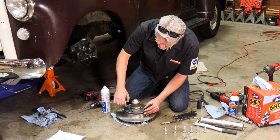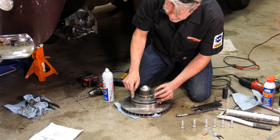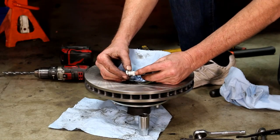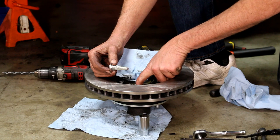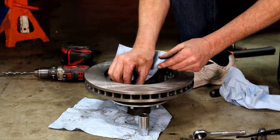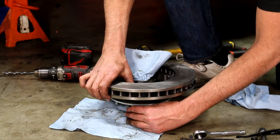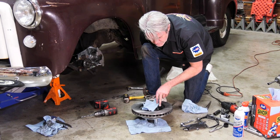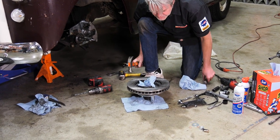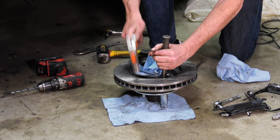When you're tightening these down, just snug them up a little bit and make sure they're going in nice and straight and even, and that they're fitting into the bevel nicely. Now you see these splines here — there are splines that are going to match up in the original hub. When you install this, try to get those splines to match up by turning it back and forth a little bit. If you don't have a press, get a socket, put it right underneath, and cover your bearings so you don't get any shavings in there. Give it a couple of light taps. Before you get hammering on it too much, switch to a punch so you don't hit the hub or the disc.